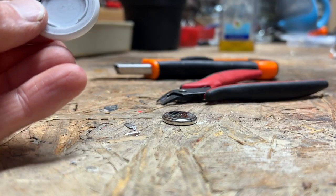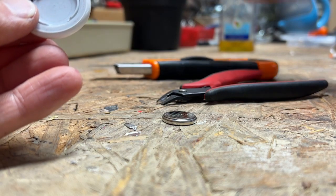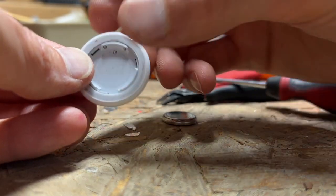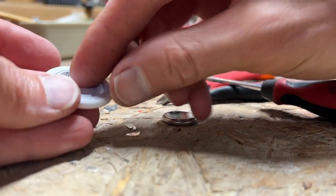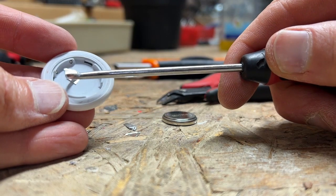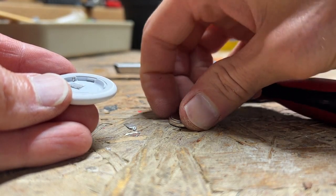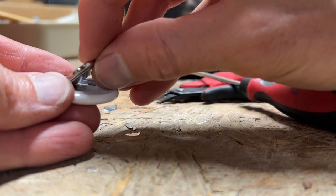This is the contact that's being blocked by the bitterant, right here in the middle. Our goal will be to place our little piece of foil such that we've got contact with that point and only that point, and then we're greatly expanding our contact area for the battery. And of course it's going to be wedged under the battery, so it's not likely to move around.